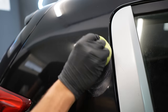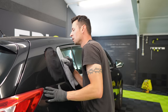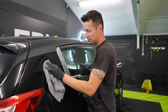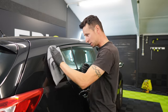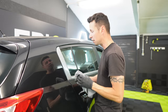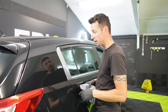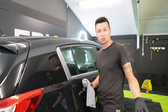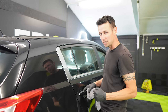For the second attempt I gave moderate pressure and was hoping for better results. Those marks are not coming out — there's no way. The rest of it though, to be fair, looks quite nice. I'm not saying it looks machine polished, but as far as a buff-on wipe-off product goes, that ain't that bad. We're testing all sorts of marks here, so it's not going to get everything out. Because it has wax in it, it tends to make it look a lot better than it is — it may be filling those little marks.